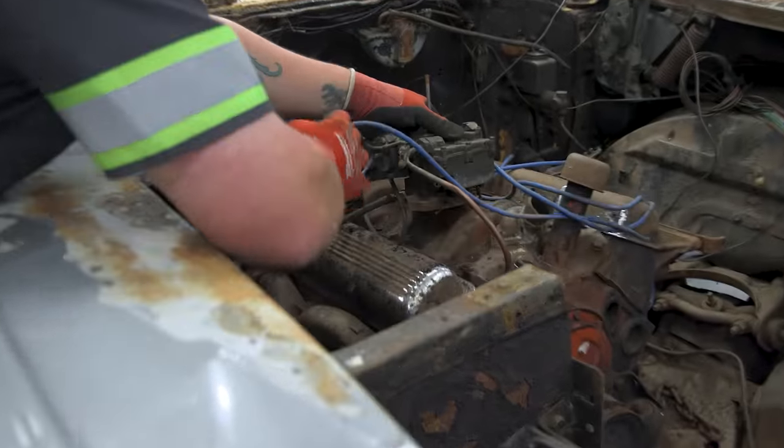Once we get the housing where we need it, Hillbilly's going to get back to work on the front suspension - that's going to take up the rest of our day. Maybe Chevy powered, but it's run by a Ford rear end. Summit Racing offers every single one of these parts, which is why we're here. On these leaf springs, they don't come with the rear bushings, so we got some Moog rear bushings. We're going to press them in with the vise - the rear leaves come with one bushing so you've got to press your one bushing in.